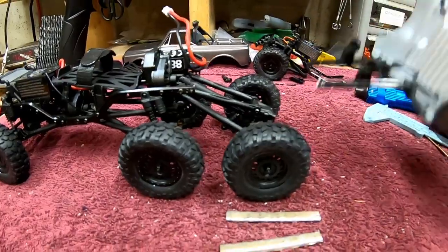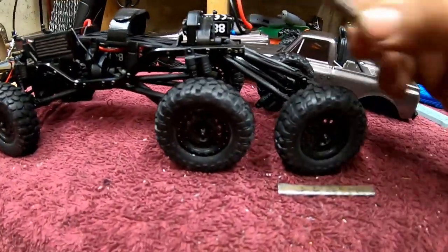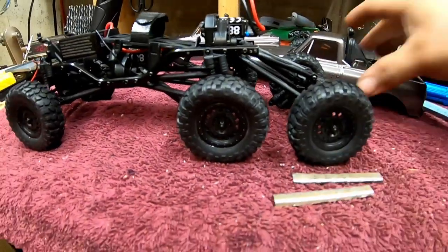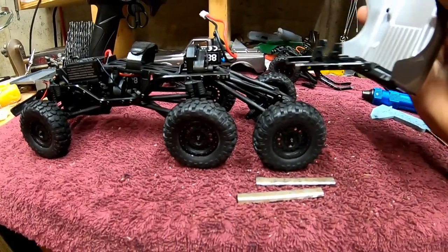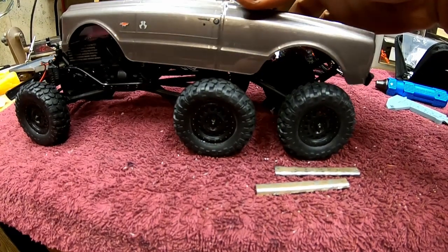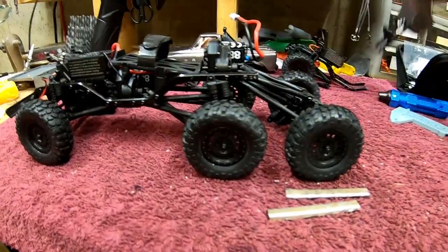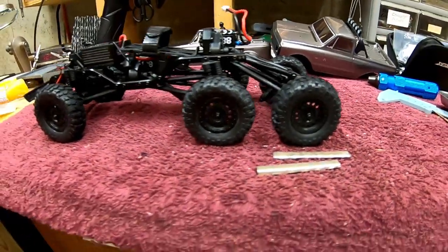I cut off the other frame and mounted those pieces to the hinge, so once these are screwed on here, I'll be able to put this in place and kind of move it back and forth and get the body to line up so that rear wheel well is correct. Then I'll cut this bed off of this body and start working on grafting the 2 bodies together.